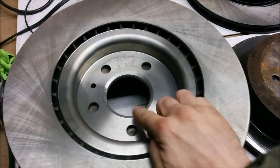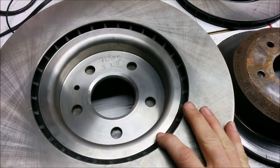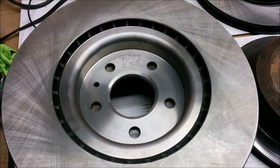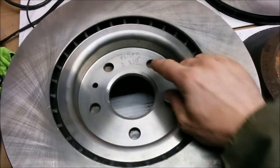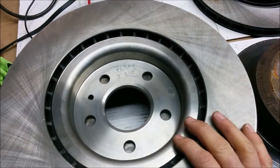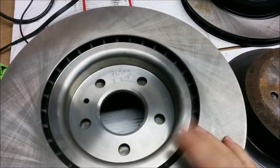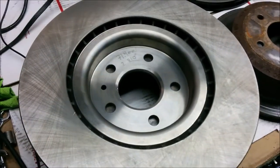In this part of the video series I'm going to cover how to open up the bore on these rotors yourself, so that you don't have to rely on a machine shop. A rotor is a wearable part and it doesn't make a lot of sense to depend on someone else for a simple brake job. The stock fifth-gen Camaro hub size is 67.4 millimeters and the GTO is 71.4 millimeters, so you have to open it up four millimeters on the center for it to fit — it's not a bolt-on application.